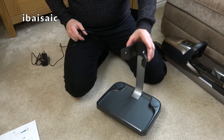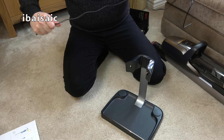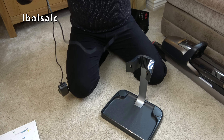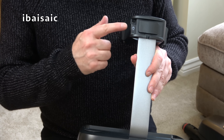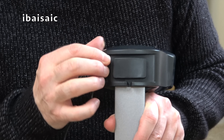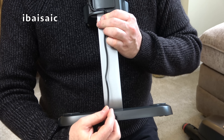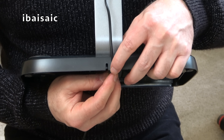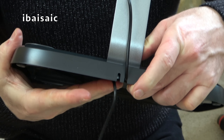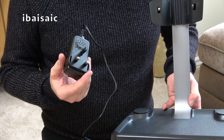That's the assembly of the charging and storage stand. To charge the cleaner we need to connect the mains adapter, so this needs to be near a mains socket — there's approximately one and a half meters of mains cable. At the top of the charging stand you'll see a plug symbol and a socket where we plug in the mains adapter. Insert it into the hole, take the cable and pass it through the little slot at the top, then down the back there are two other slots at the bottom. Pass the cable through one slot, coil it round, and bring the cable out the other side. We can now plug in the mains adapter and we'll be ready to charge the AEG vacuum.